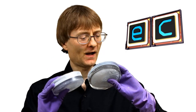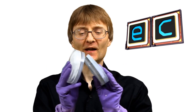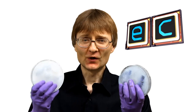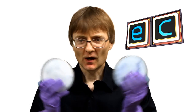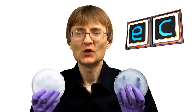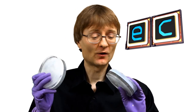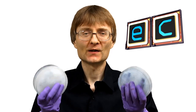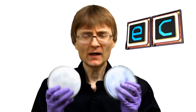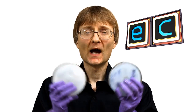I'm wearing these lovely designer purple rubber gloves because if I didn't, my skin would be sticking to this. It is really very, very cold and very solid. Why have I frozen these discs in ice? I'm trying to put the discs through the stresses that they really don't like. These sort of discs don't like moisture — and clearly this is quite a high moisture level. They don't like extremes of temperature — they've been down to well under minus 20 degrees centigrade for many hours today. And they also won't like high temperatures, so I'm going to get them out of the ice not by letting them melt slowly, but by subjecting them to some boiling water.